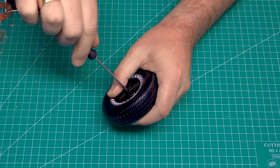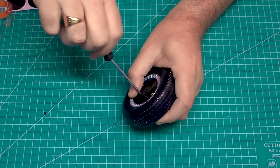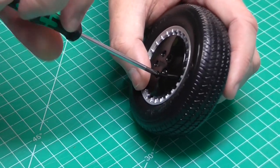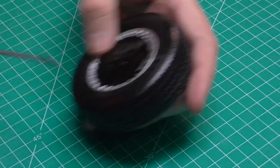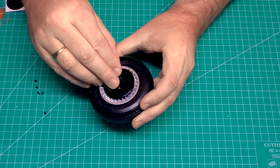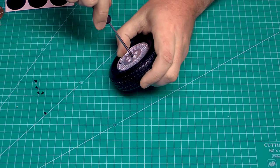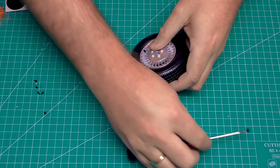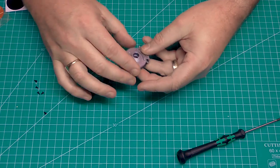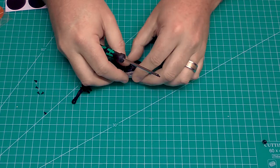The advantage of doing this is I can put both modifications on at the same time, so I'm going to take all the hub screws out as well. I never did like these screws in here, but I'm glad someone's thought about how we can hide them. So they're out and that's the hub off. I'm going to take this screw out here as well — remember this screw did have a washer in it so I'm going to keep that to one side, and that's going to drop the whole brake system out.